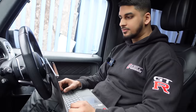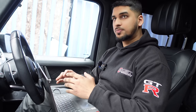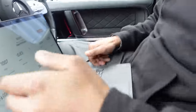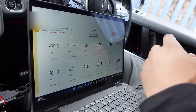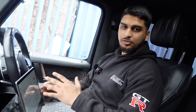What else can you do to this car? The possibilities are endless. You can go Stage 3 turbos, bigger turbos. If you really want to go all out, the engine can be pulled out for a full forged build — forged pistons, forged rods — you can go to about 1200 bhp or more. Let me show you what the log screen looks like when I'm logging the car. As you can see: RPM, boost pressure, engine torque, wastegate duty, intake air temperature — all of this is very important. When I'm logging the car I'm looking for too much heat, over-boosting — if the boost is too much or too little, we fine tune it and get the results to be perfect.